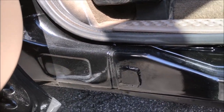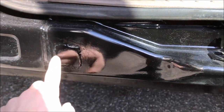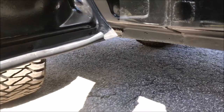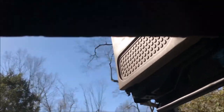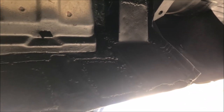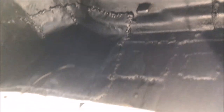Everything that was rusted has been gone through. This area used to not even be here — it was gone. We get under it now just to prove there's no more rust on this thing. This is a brand new inner rocker panel that we got and it's welded in — it's all undercoat on it now so you can't really tell, but there's no rust. These are new supports that we put in, welded in by the welder. I'm going to undercoat the whole entire cab eventually.